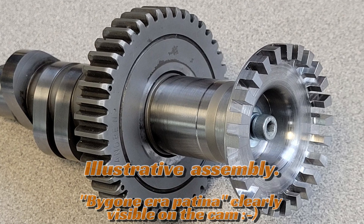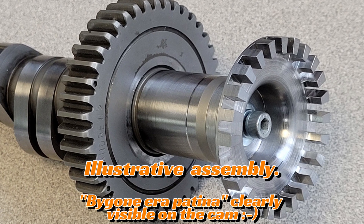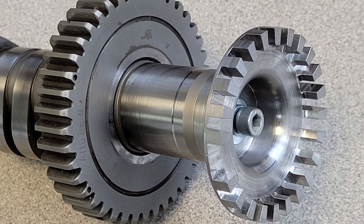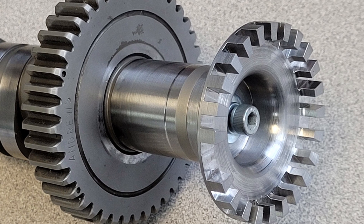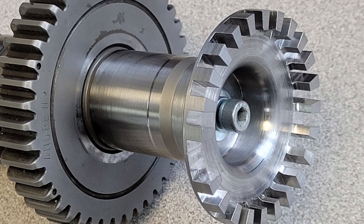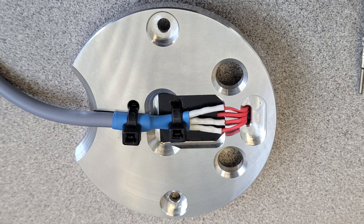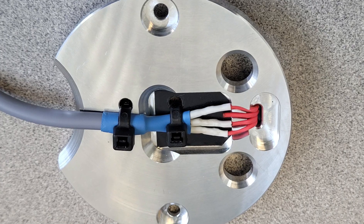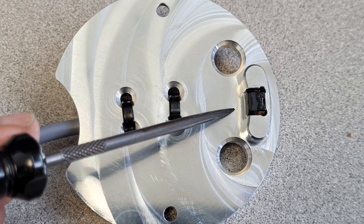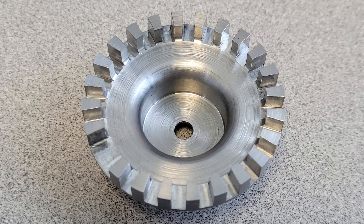We mounted that trigger wheel at the end of a camshaft. Luckily MicroSquirt allows us to do so and it does read the correct information about where the engine is at any given time. The ECU processes that information and produces the correct amount of pulses at the right time. This is the arrangement we've engineered — this is the Hall sensor mounting plate or mounting bracket. The black small box is the actual miniature Hall sensor and it works with a 24-minus-1 trigger wheel made out of mild steel.